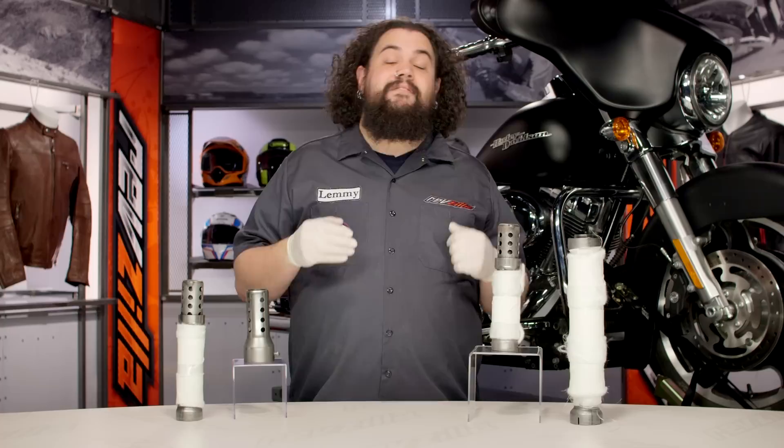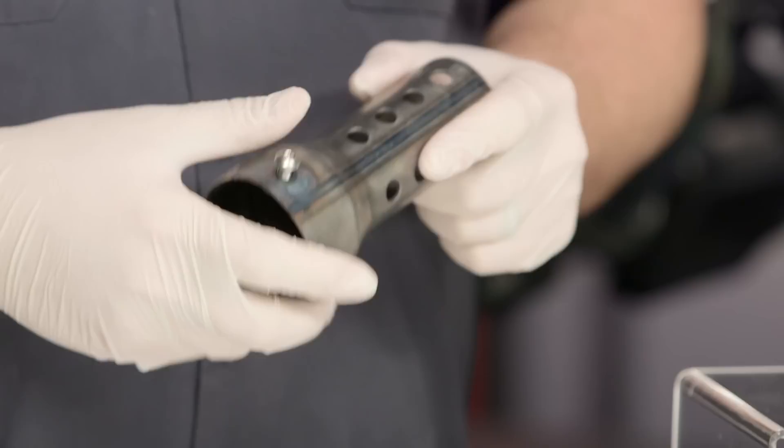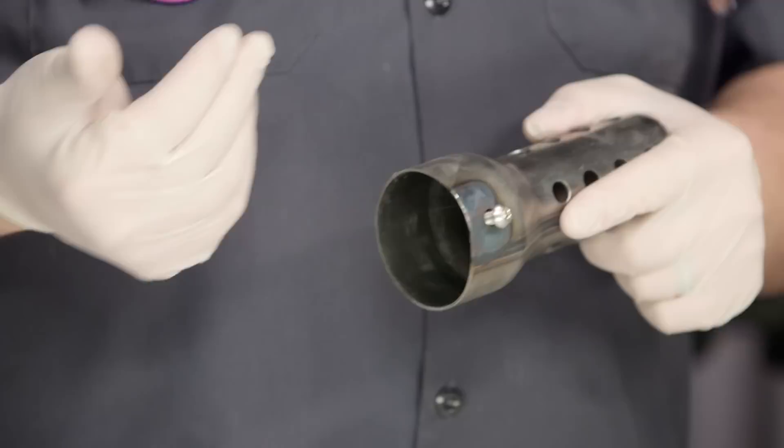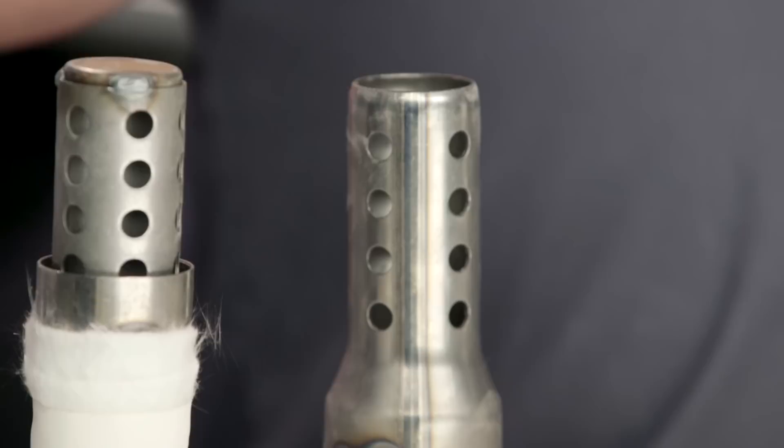Installation really is cake. There's one bolt. You can see here on most of these baffles you're going to see either one or two bolts on your existing muffler. You're going to remove those — typically they're held in place with a hex-headed fastener and you're going to use a hex key to remove them. Slide those baffles out, slide the new ones in, put the fastener in after you line it up, bolt everything down, and now enjoy your new, much less loud exhaust.